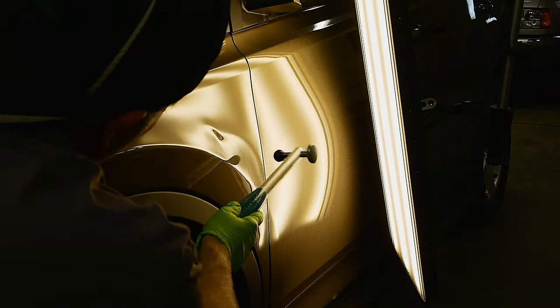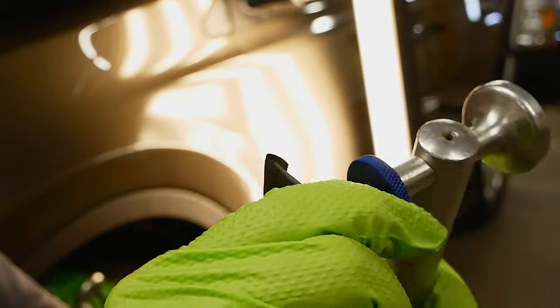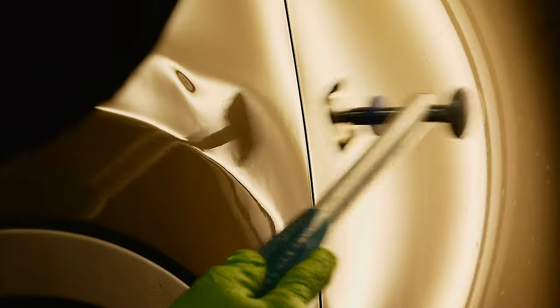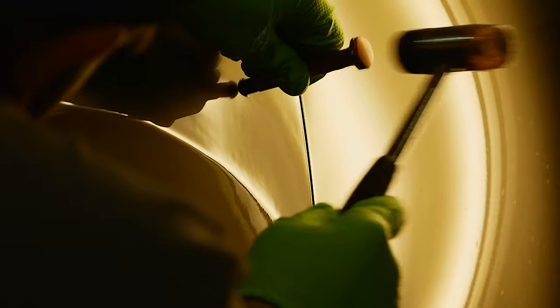After that, I switch over to a crown tool with a little bit of Tessa tape on it so I'm not hitting metal on metal. This process lets me bring down a lot of that crown — it's holding a lot of tension and taking quite a bit of work to smooth down. I can use it with the hammer, or lay it against the panel and hit it with another hammer for a little more force. I'll also be using my knockdown with a rubber cap on it, which helps me be more precise and knock down right where I need to.